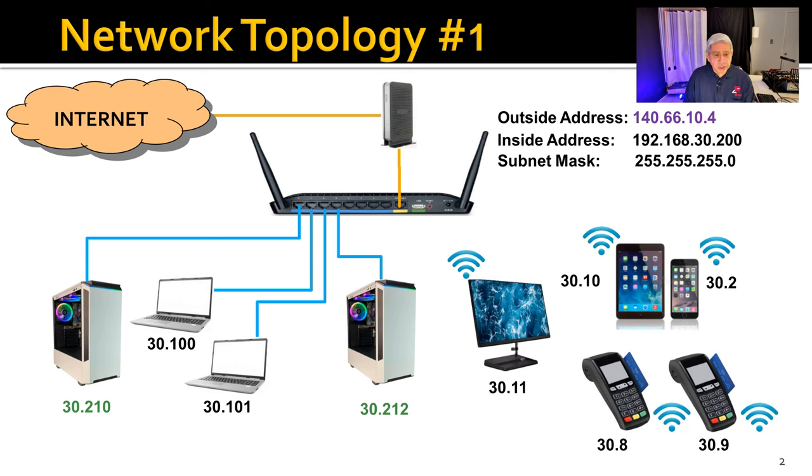We also have many wireless devices — all-in-one computers, iPads, phones, even point-of-sale terminals for a small company. These addresses come from a range we pick. You can define the minimum and maximum address range within the 254 allowable addresses that will be automatically assigned by DHCP when a device connects. Two of the devices — the two workstation towers, shown in green — have been statically assigned in the router. All the rest get addresses through DHCP, the service running on your router that dishes out addresses to newly connected devices.